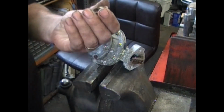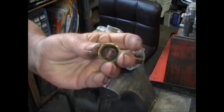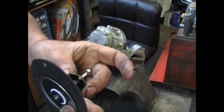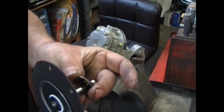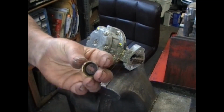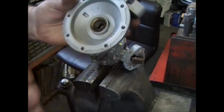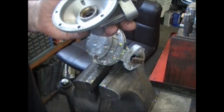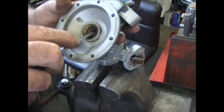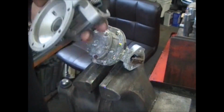Okay, I located one in the trash because I just throw them away. As you can see, that's keyed also. And the pull rod sits down inside of here. So once you release it from the link, it's going to come up and hit that. Turn it 90 degrees again, and it'll slide out. And this just pops. It sits down in there, and you don't need it anymore. Take your screwdriver, put it down inside, and just pop it to one side, and it'll pop out. Throw it away. You don't need it. You're not going to use it again.